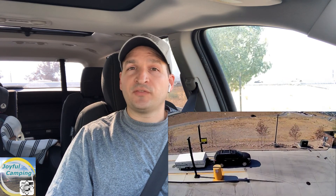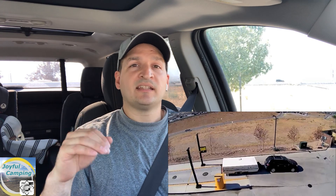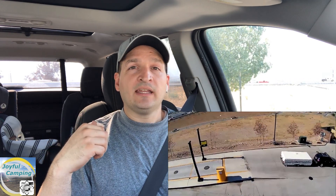Keep in mind that as your trailer bounces down the road, it can cause additional weight to be pushed on that tongue. So if you happen to be close to that 500-pound limit, you probably don't want to be there, because weight in motion adds additional force and can push you over that 500 pounds. This trailer is basically fully loaded — not bare bones weight at all — so I wanted the full weight so I knew exactly what my tongue weight needs to be and that my vehicle is capable of towing it. Now let's go do the bathroom scale measurement and figure out the tongue weight.